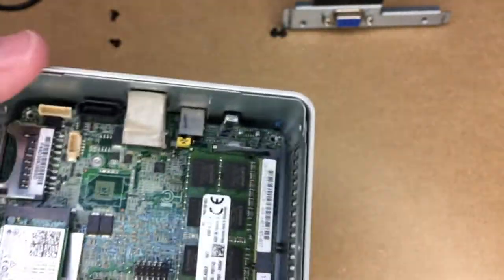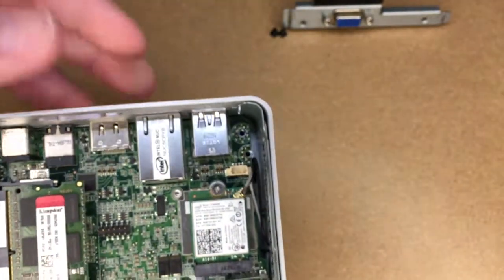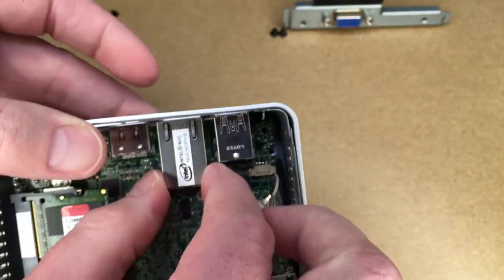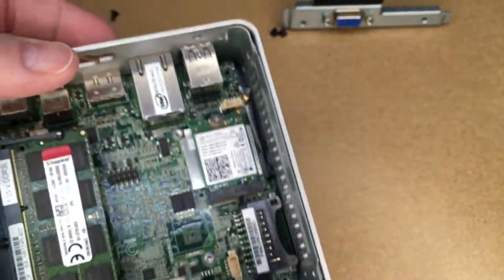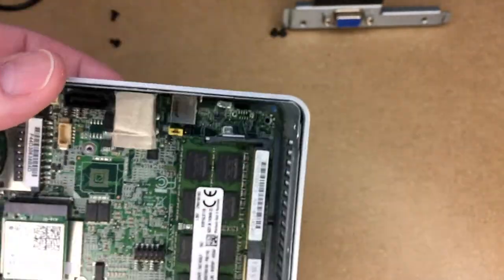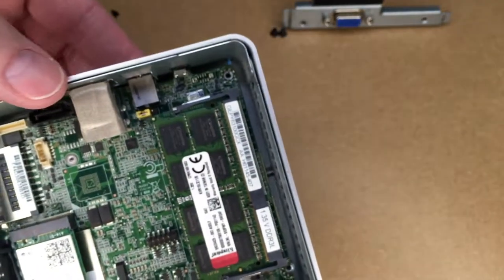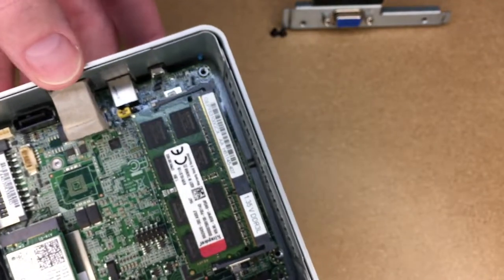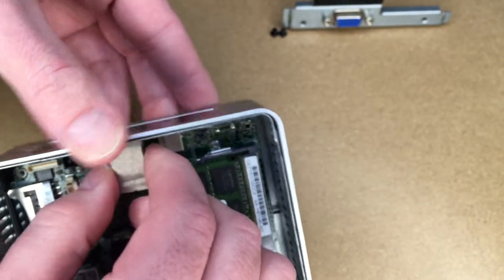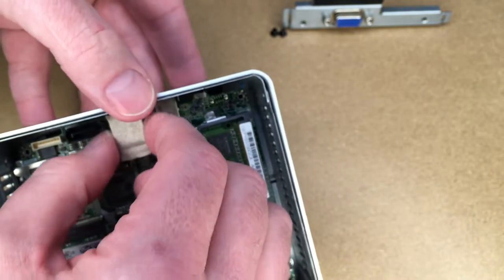This is where I ran into trouble taking it apart. The case is plastic and you can flex it. You can take the ethernet port side and kind of pull it out, but I couldn't get it all the way because it got caught on a little ledge. When I try from the other side, it gets caught on the headphone port. So what I do is pull out just the plastic, not the metal shielding around the headphone port, and pull up on the USB ports — gently, you don't want to rip things off the motherboard.